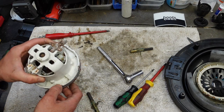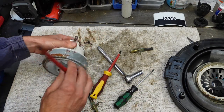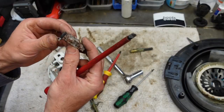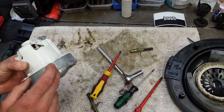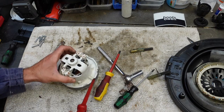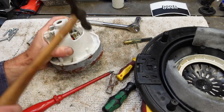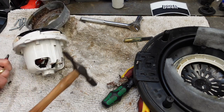So I'm going to have to unwind it by one stage. Let's try and get the other brush off first, which is indeed bringing the stake out with it. When I say the stake, I mean that little brass spade connector - so that's completely rubbed as well. So to get that out, I have to get this off. To get this off, I have to pinch back those fellows. Tappy tap tap. No time like the present. There we go.